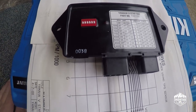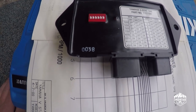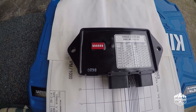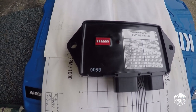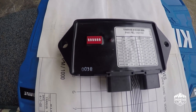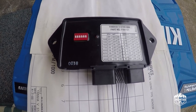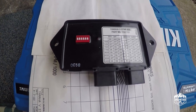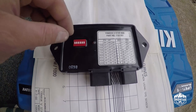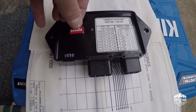I've come to the conclusion that initially I'm going to try seven and a half thousand RPM as my rev limit and I'm going to try curve three. Curve one and two are for stock bikes, three and four are for jet kits, five, six, and seven are for heavily modified bikes, and eight is retarded ignition for nitrous and turbo. So I'm thinking with the level of modification I've got on Dizzy at the moment, it's probably curve three.